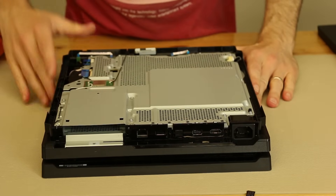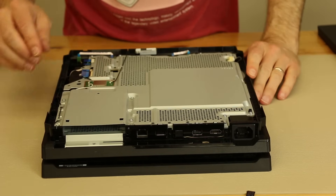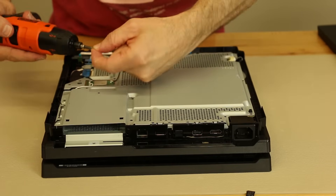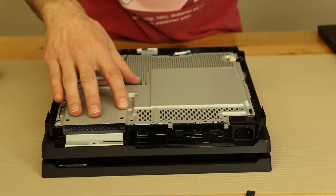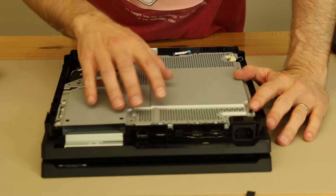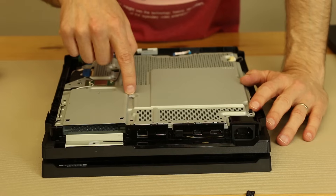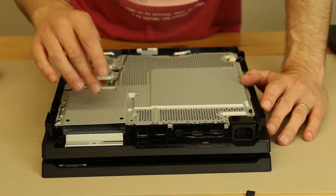The first thing we're going to do is remove all the silver screws from this plate, and it also has black screws right along this front edge. It also has the Wi-Fi cables right here, and the ribbon cables for the disc drive are located right there. Now if you guys ever get stuck trying to figure out what screws go where — the black screws go into all of the metal holes where they screw into metal. The silver screws are the larger ones and they screw into plastic. So keep that in mind if you ever get them all mixed up.